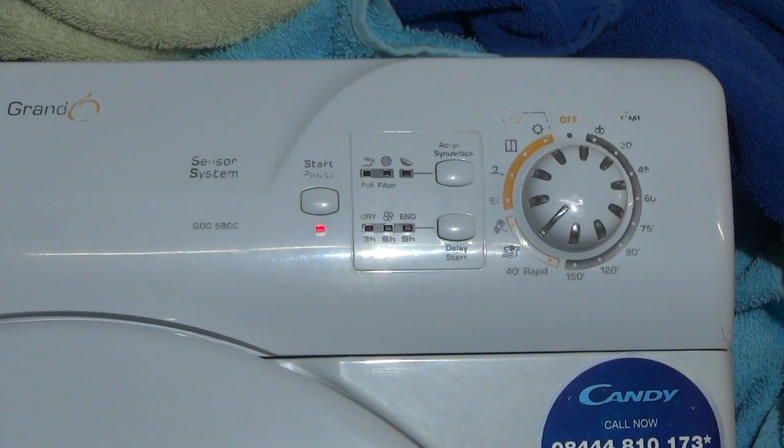We've got what looks like shirts, but it isn't. It's known as an anti-crease or easy iron, to put it another way. What you do is put in a small load of clothes that are heavily creased. It uses heat, of course, to relax the fibres, and then you take them out and you can then iron them. So it will make your iron days a little bit easier with those heavily creased items. No need to keep rapidly using the iron. The reason why this is quite special rather than using a normal timed mode is because it heats for about 10 minutes, then does a cool down for just 2 minutes. So there's still loads of heat within the clothes.